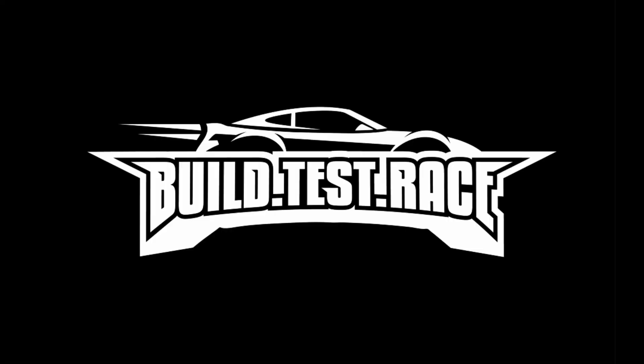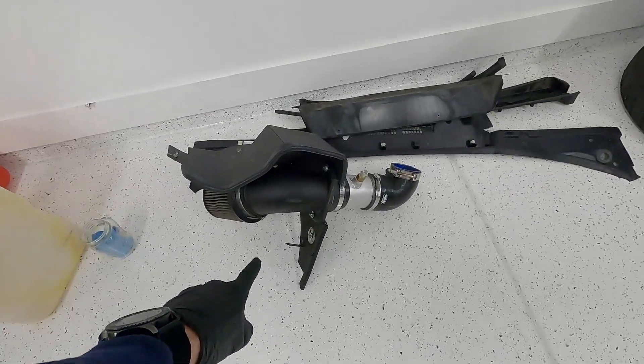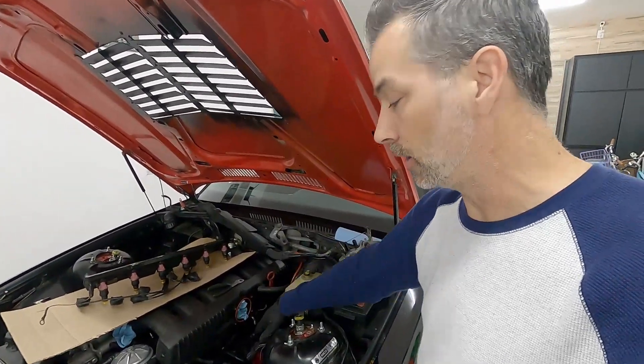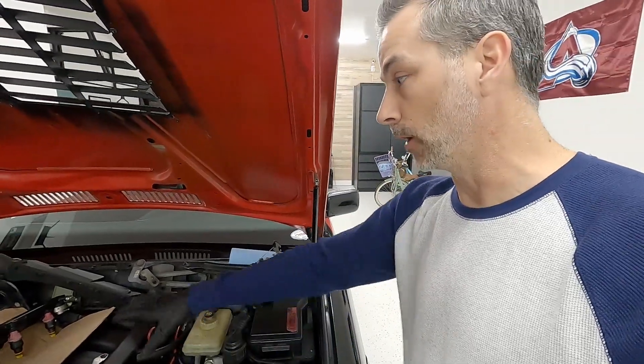We also have a CAN lambda for the ECU. Let's catch up with where we are — we have a lot of the car taken apart already. We've got the air intake out, the throttle body moved aside, the fuel lines disconnected from underneath the manifold, because we're going to take off the entire manifold so we can get under there and fix the sensors and the wiring. It's just much easier to get to with the manifold out.